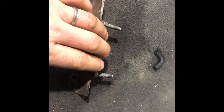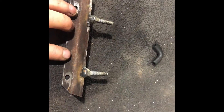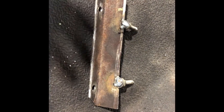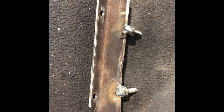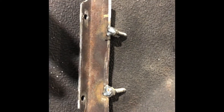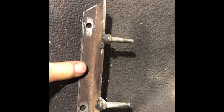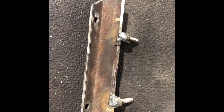Then what I done was I loosened off the nut and slid my pulley out. I'll show you that in the next screen — you'll see the way I pull the thing up. It's as simple as that silly little bit of steel, but it'll save you taking off the timing chain in its totality. I will say this: if it goes wrong, this isn't me telling you to do this, but if it goes wrong it doesn't really matter, because any decent mechanic will not turn the engine anyway. If it goes wrong it just means you have to do the job that was standing there anyway. But this is what I've done, and if it went wrong I'd have to do the full job. If it didn't go wrong — and it worked — you'll see it there.